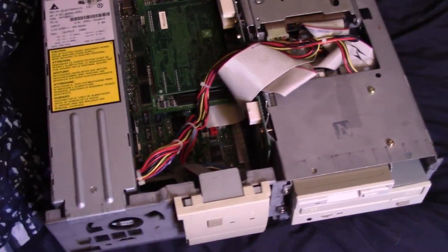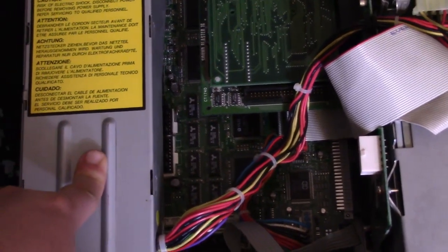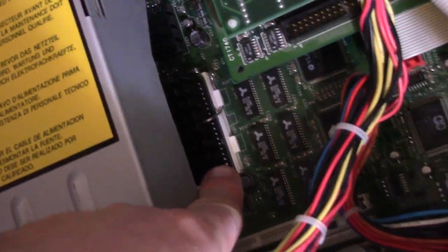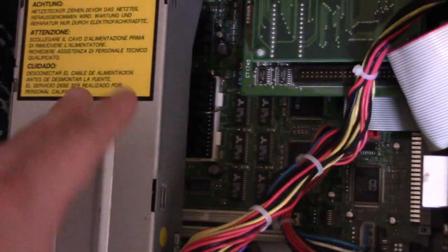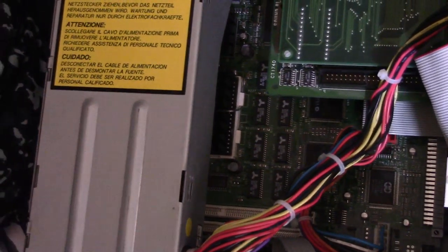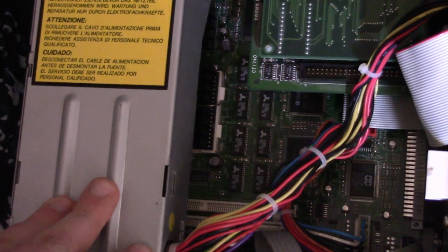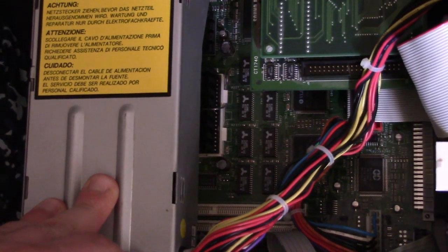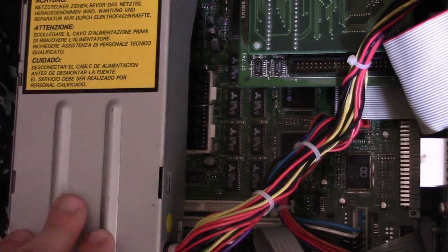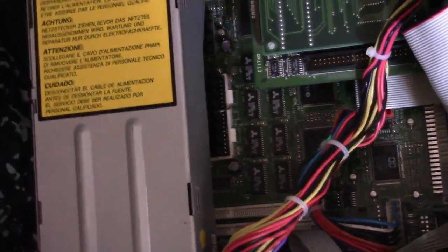All right, so some of the progress so far. Ran some benchmarks, confirmed that it is a 200 megahertz MMX CPU overdrive on this thing, and it scoots along very nicely, although it gets extremely hot. Unfortunately, I looked all over and could not find my Pentium 90. I know I have one, I just have no clue where it is. So I did find the gold top Pentium 75, so for right now I'm just going to put the Pentium 75 in there to slow it down more around to where I want it. Hopefully on this board and this machine that won't give me issues with the card I want to use like it did in the last machine, but we'll see.